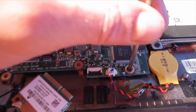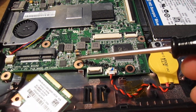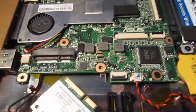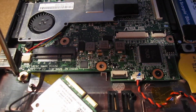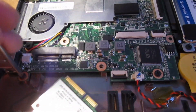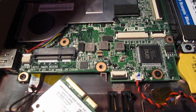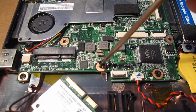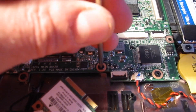On most of the screw holes you can see there's a little arrow pointing to the ones you would need to remove. The only one I think that doesn't have it is up here, and of course the one holding the wireless card in. Remember the three long ones — one goes basically on that heat sink and the other two longer ones go up toward the left corner.